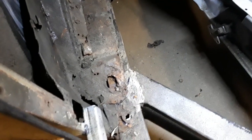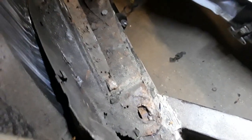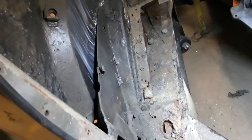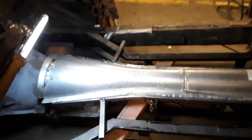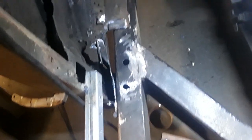So I have to cut this away and hopefully find some decent metal back there that I can weld to. Otherwise I'm going to have to do like I did back on the B pillars and just weld metal structure in to be strong enough to hold everything. Well, that was more solid than I expected, so I'm going to have something good to weld to here when I get some more metal. Anyway, thanks for watching — please subscribe, comment, and share. Appreciate it.